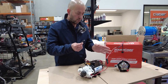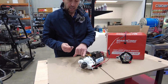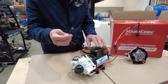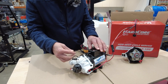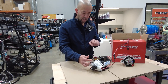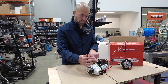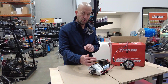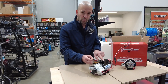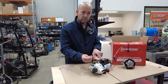Here's a tip and trick: when you change a cartridge, keep the plug assembly from that old cartridge. With the pump circuitry's leak detection system disconnected, the pump won't run. But if you take a plug from an old cartridge and plug it into your Everflow pump, the pump will run - the pump logic is satisfied that the circuit is complete. If the circuit is then connected to the two probes within the cartridge assembly and we get fluid over them, the red light comes on after a few seconds. Dry the circuit out, the logic is satisfied, and the pump will run.